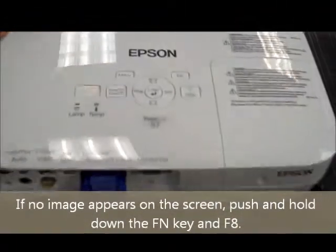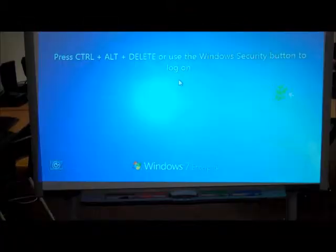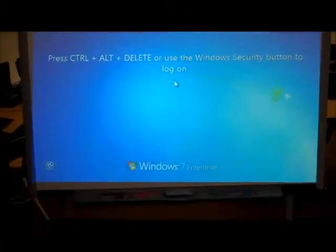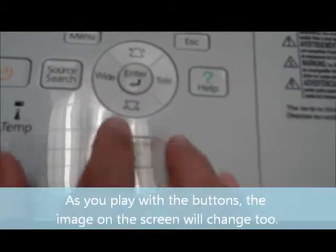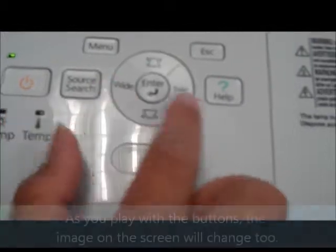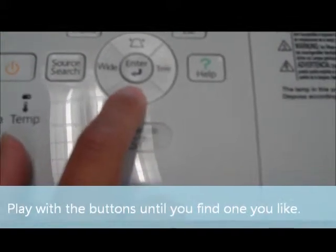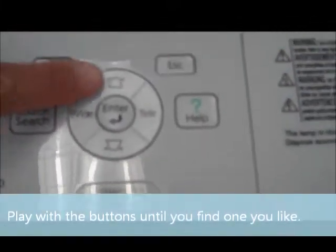Here is where the button on the lens is where you would focus or unfocus the image on the screen. Once you have it focused, it's kind of like a camera. You can go to the keystone in the middle, and these buttons will make the image on the screen wider, smaller, or closer. Just play around with it to what you would like. We're going to use the zoom so that the image on the screen gets bigger — zoom in a little bit more. The bottom arrows make the bottom of the image smaller, and the arrows on the top make the top of it bigger.